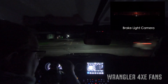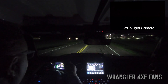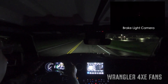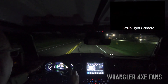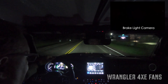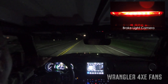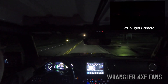Here's where this gets interesting. There's nobody on this road, so I'll be able to demonstrate this really easily. If I'm driving along and do not have max regen on, I'll let my foot off the accelerator and then put my foot on the brake, and you see the brake light come on. Now let's do that again, only this time we're going to turn on the max regen in the middle of that. I let my foot off the accelerator, I'm pushing the button, but I'm not putting my foot on the brake pedal. And as you can see, the brake lights come on by themselves. I'll put my foot back on the accelerator, and the brake light goes off.